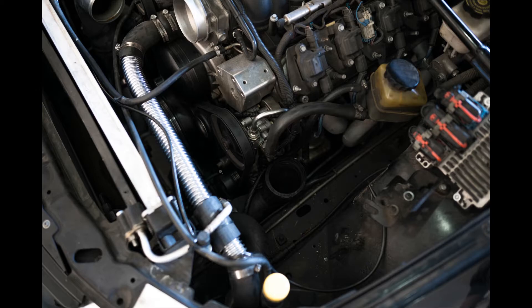After taking those three bolts out, take the ProCharger off. There's a small nut bolted onto the alternator bracket right here — be really careful with it because it can fly off. Mine fell into the skid plate and I had to go get it. If you're using magnetic tools it shouldn't be an issue. Then loosen the hose clamp to get the ProCharger off the intercooler piping.